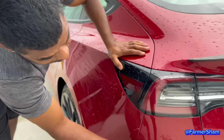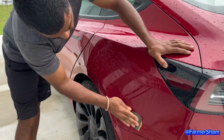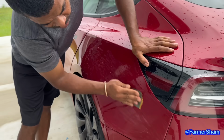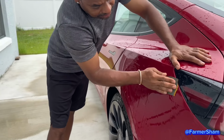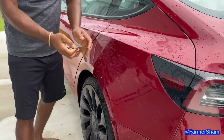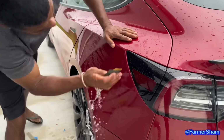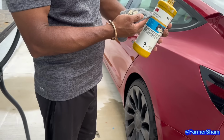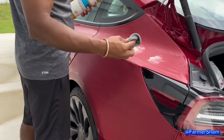Here on the back here. Just a light sanding, for whenever there's dust in it. Yeah, put some compound, polish it out. Okay, let me finish sanding out the 1500. Then I will come home. Wet sanding, right? Good. Now rubbing compound, right? Now we have put some here, and ready to sand it out.